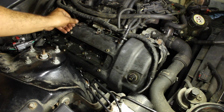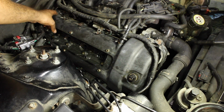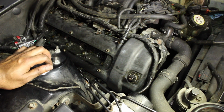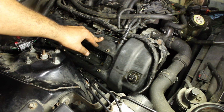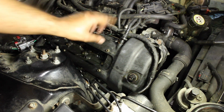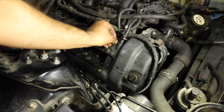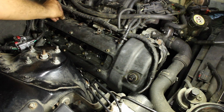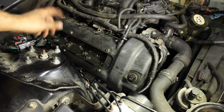We're good. And now basically all you want to do is screw all these in. Don't forget the bolt that falls out. And again, they're like shoulder bolts. Once they're tight, they're tight. Don't keep going. You'll probably break the nut, break the bolts, or crack the housing. Do not. Just tight, you're done, because it has the thing in it that shoulders it. But if you just start off by putting them all in the threaded holes, you'll be good. This is easy, guys. I'm going to fast forward through it.